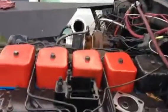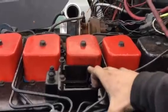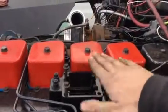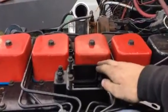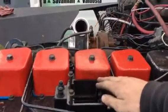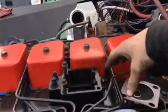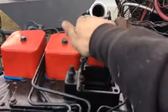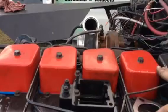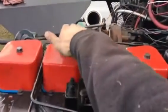I have a 12 valve Cummins, the older ones with the VE pump, non-intercooled. I have their crossover tube because I'm not going to have enough room right now to run an intercooler. However, I did not know this, but the intake for theirs is 1 square back. So theirs goes over and then kicks this way and hooks there. Mine, since it's the same, it goes over, it kicks here, so it doesn't line up.